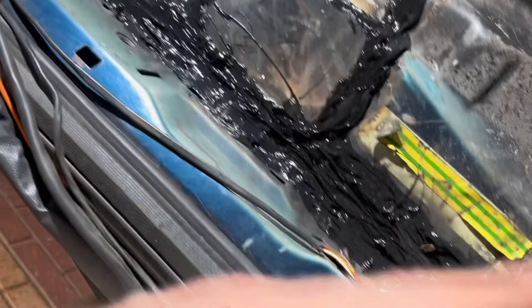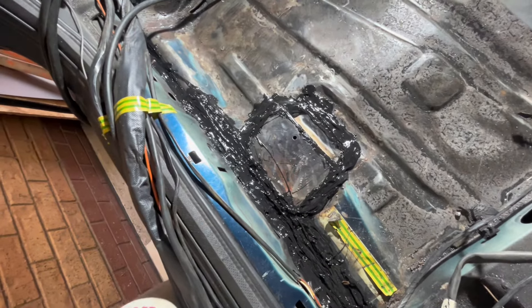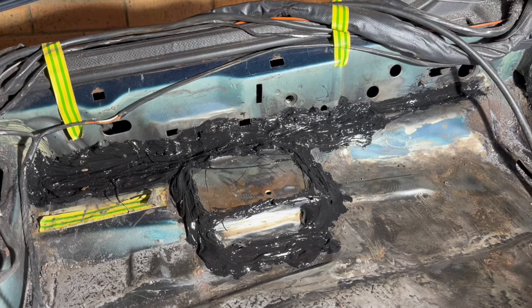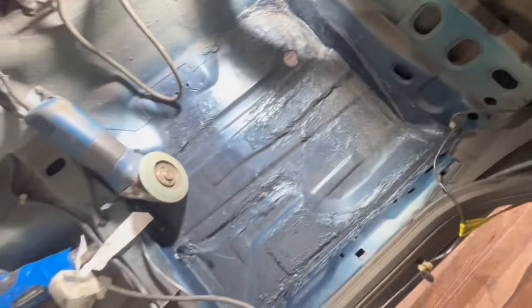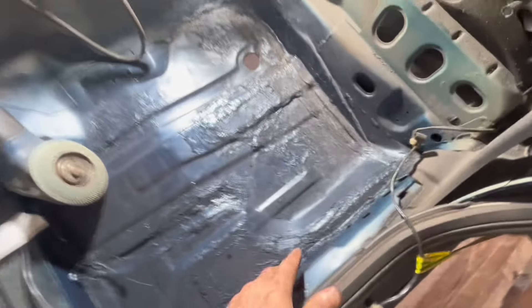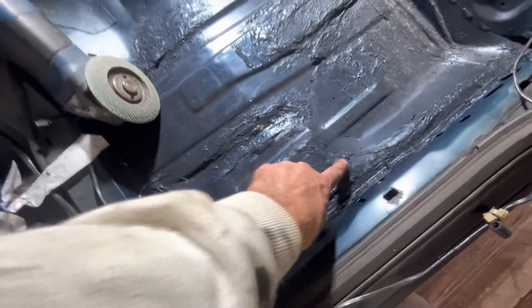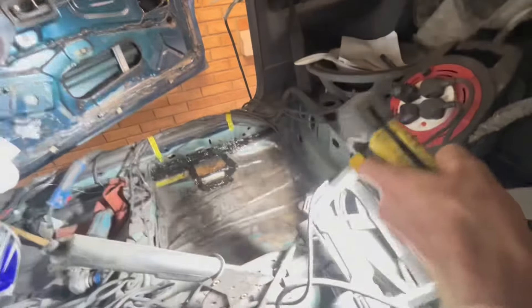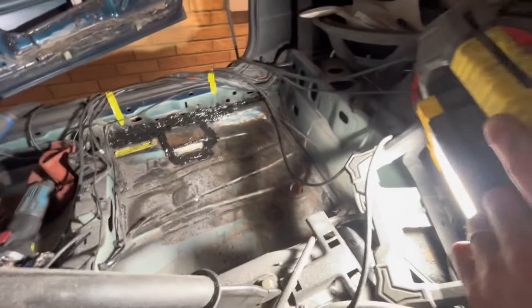So I'm going to show you quickly. I've done like I did the other side - I put a plate that is in sealer now. I've been busy and this is all done. I built the section back up for the floor and put the right angle steel in there like I did this side. I did the right angle all the way across here and all the way down here. I did the plate on here - I didn't have to build this one up, but this one I had to completely build. I've cleaned all the floor now and I'm just waiting for that sealer to go off, then hoover it and get that side into etch primer, and hopefully a bit of colour.